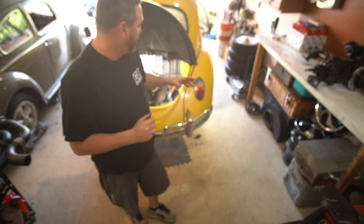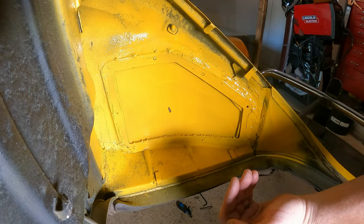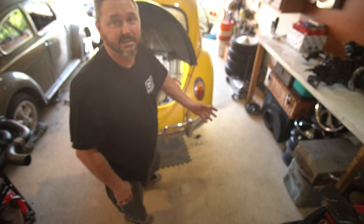I've already done one, and what you can see here - we cut the hole, we welded in the brace on the inside, and then we bolted the panel from the back. Then I did some seam sealer and some undercoating and a little bit of paint, just to keep it kind of nice. I mean it's just spray paint, it's not color matched or super fancy, but it looks good - better than whatever the overspray and black stuff the last guy put in there. It just looks terrible. So this will be a lot cleaner, a lot nicer, and we'll have a lot better access. Let's get in there and put in a Weber window.